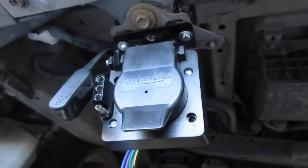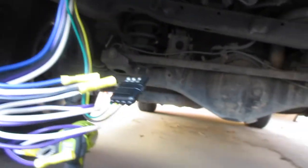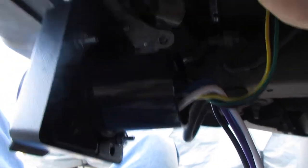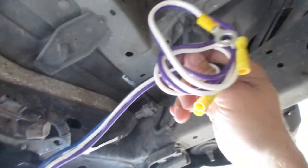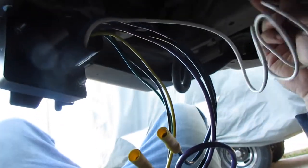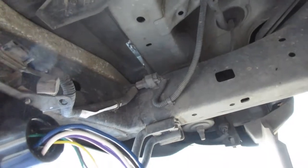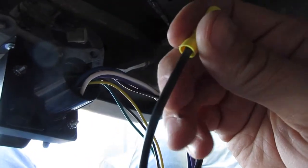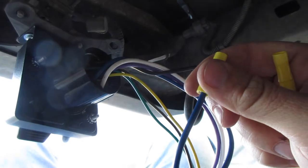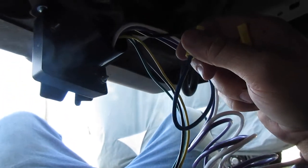You can see it mounted. The thing with all these wires here is this connection from the new plug — all you're going to do is take it up here and plug it into your old one. We've got these wires here: white is just going to get grounded to the chassis somewhere, black is our power wire which is the red one coming all the way to the back, and blue is coming from our brake controller all the way back. We just have to run those inside under the panels and get them hidden.